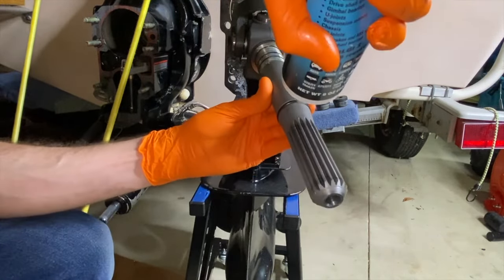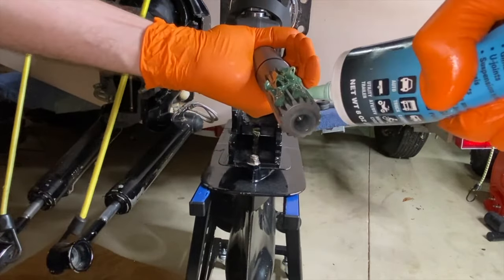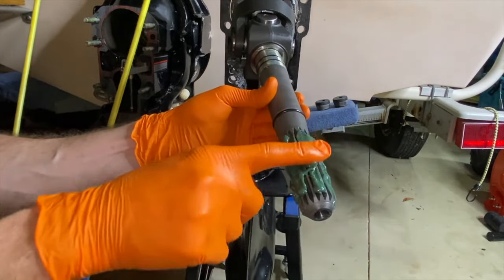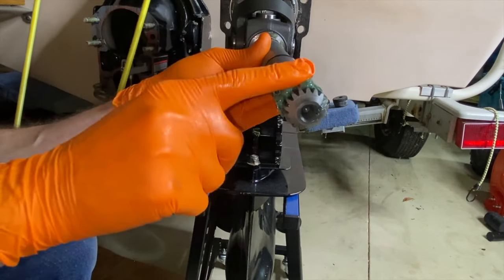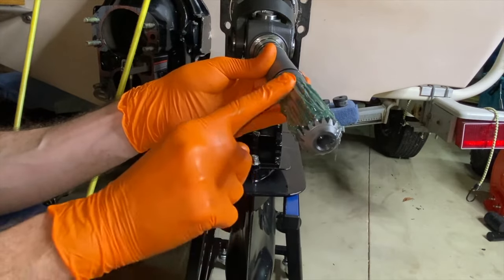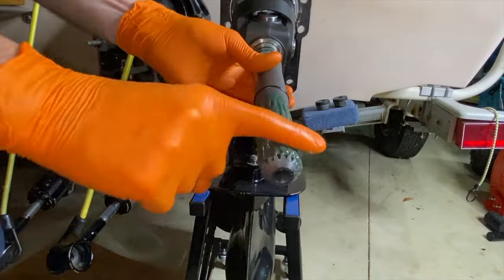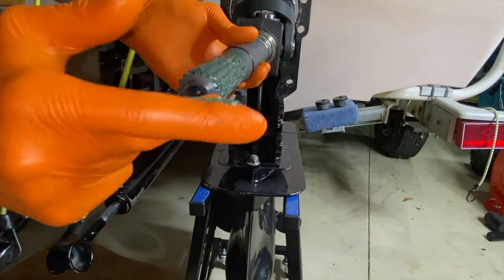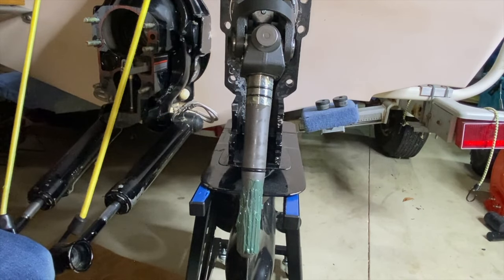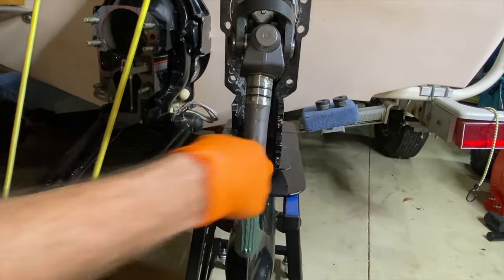I'm going to apply a good amount of this high-performance grease all the way around the entire shaft, and work it into the splines. Do not get any of it on the tip portion of the shaft — that could work against you as you shift the out drive and shaft into position inside the coupler. The grease, under compression, may push back and not allow you to properly shift the shaft into the coupler. Now with the spline properly lubricated, for the O-ring on the shaft — if you have a newer engine with a re-engineered coupler, apply 2-4C to the O-ring. In our case, it's irrelevant, but here is how to lubricate it.